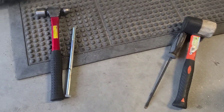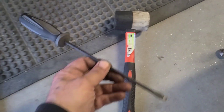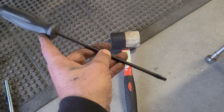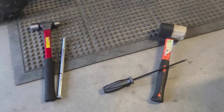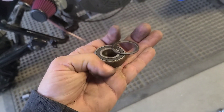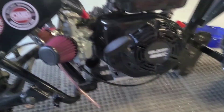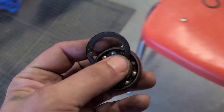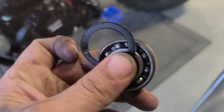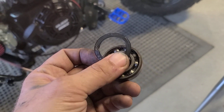What I mean is you want to maximize your bludgeoning force. Something like a screwdriver is not gonna do it — that's gonna bounce off and it's gonna gouge your seal. In this instance, both of the inside seals were sitting inside of the tube. This one I had smacked with that screwdriver. Speaking from experience guys, don't do that.